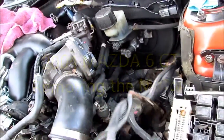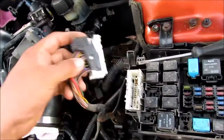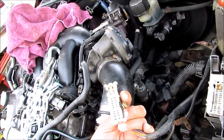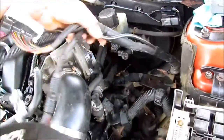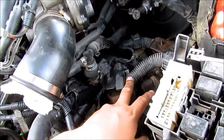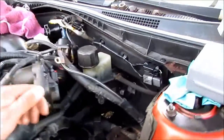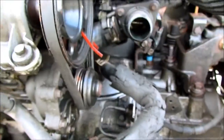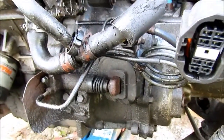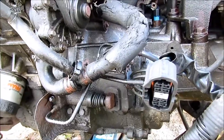Okay folks, made it this far. Disconnecting your wire harness right here — take this little piece, pull it up. I got corrosion by the looks of things. This wire harness stays with the motor and this one comes off the motor. I still got to get there, but I just gotta disconnect a couple hoses in the back and remove the clutch. I'm not going to disconnect the hydraulic lines — I want to keep it like that so I don't lose any hydraulic fluid or get air in the lines.